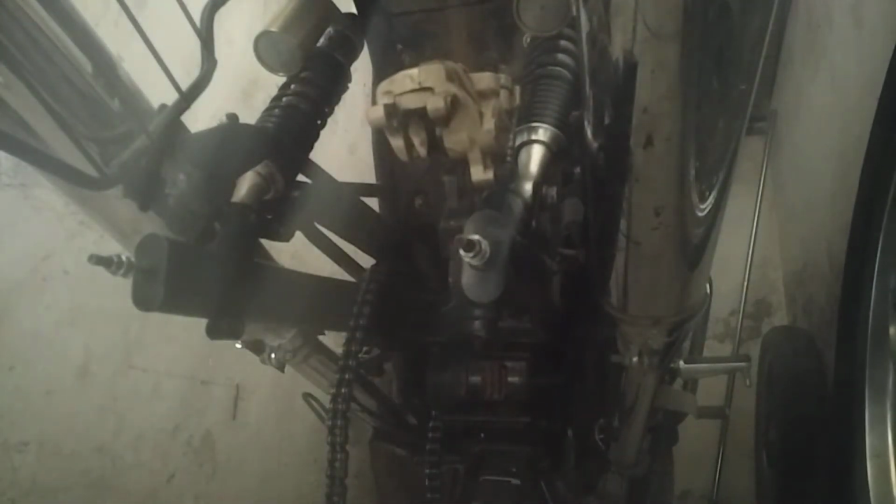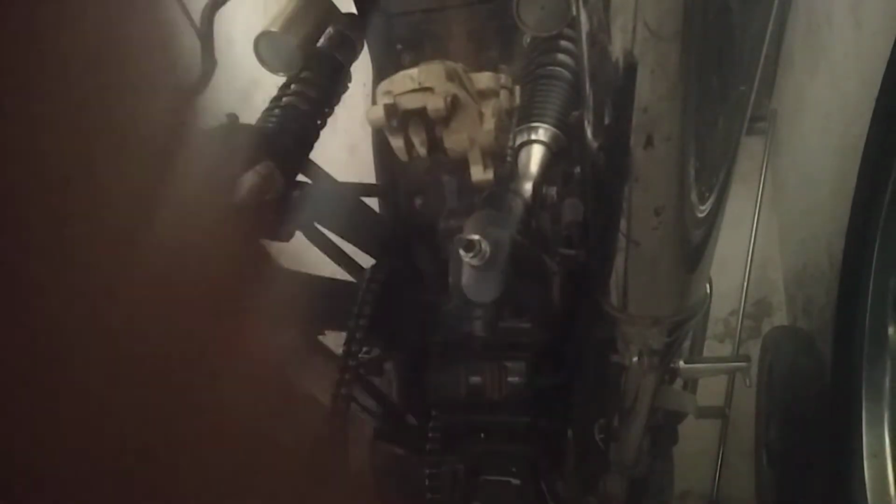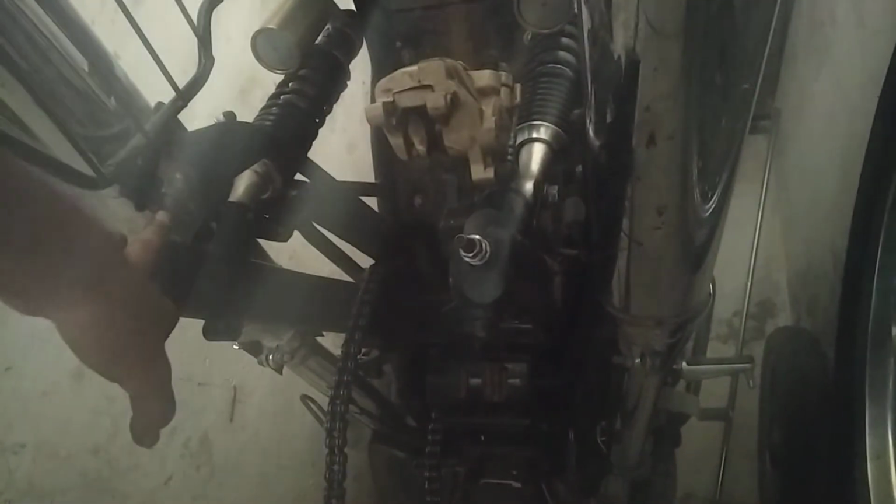So now I could see that my tire is not wobbling due to these hubs, and it's because of something else. So this doesn't seem to be faulty. The axle is fine. Maybe then either this entire hub is defective, because there was slight wobble, damage it a bit more, or maybe the disc plate is also damaged. So I will try to use a spirit level device and see if the disc plate is bent.